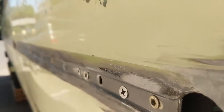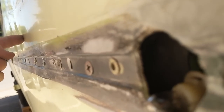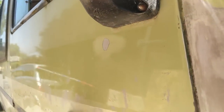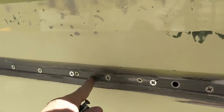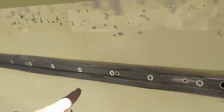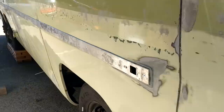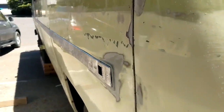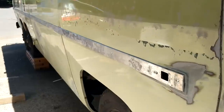Adding two screws between each of the existing screws has certainly made things better, but we can still see pretty substantial rippling. The chipmunking has been transferred to this area which is really bowed outwards now. I've got eight more screws I could still use, but I'm worried I've basically made a perforated seam ready to tear — just weakened it in a straight line ready to break off. I think I'm just going to accept this the way it is. The ripples aren't too bad and it might equilibrate over time. I don't want to weaken the fiberglass any more by adding more holes.